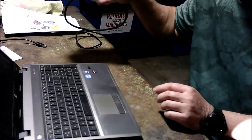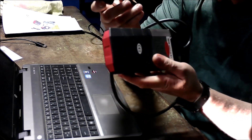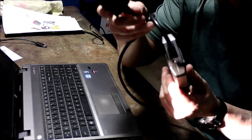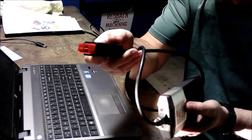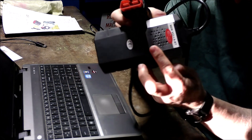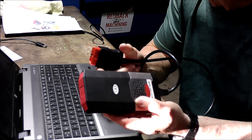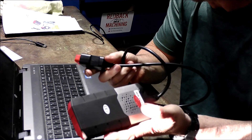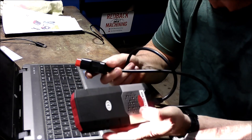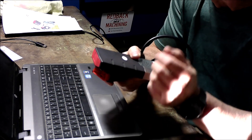The hardware you'll need is a laptop and this part here which plugs into the car's OBD2 port under the dash. If you do a search on eBay for DS150E you'll get a whole heap of these come up. You can choose whichever one you want. This is the Bluetooth model that will also plug into a laptop via USB.